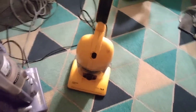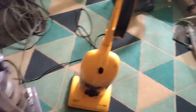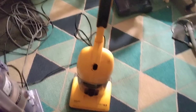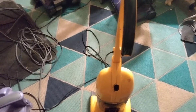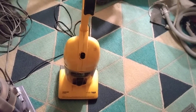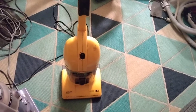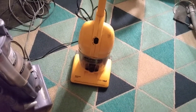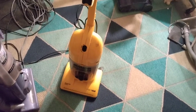I have a slight update on the Eureka TheBoss Superlite. I did take it apart and cleaned it up a bit, however it seems to be a bearing problem on top of a little bit of scraping of the fan. I'm probably gonna have to tap the fan up on the motor shaft a bit more, because otherwise it just makes a loud scraping noise. Or I could see about getting a Eureka stick vac and putting the motor out of it into this one, because that's pretty well what it is — a stick vac motor.